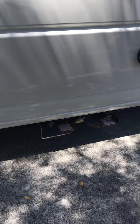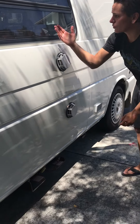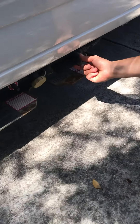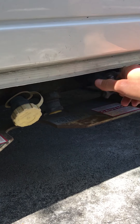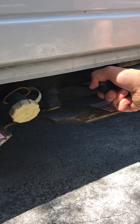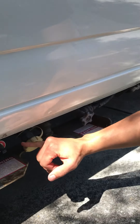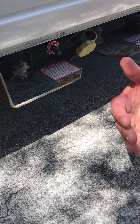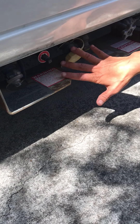There you have your gas. If you come down here, you'll see features like this on the vehicle — that's just exhaust for when you're cooking in there. Down here is the propane — I turned it on already. Righty tighty: all the way to the right means it's off, so I'm going to turn it off now. I suggest not driving with your propane turned on. Always make sure when you leave your site for the night that it's off when you start driving. This area is where the propane gets filled, but I'll always make sure you have enough propane for your trip.